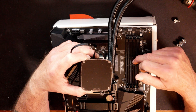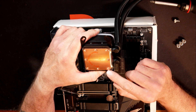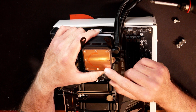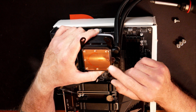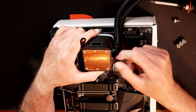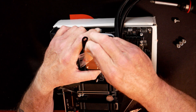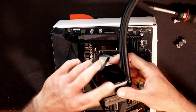Your hoses do need to be by your RAM slots. It says 'please remove before install' — if you don't remove this piece of plastic, your CPU will definitely overheat, and you'll have to take this back off to remove it. So you want to make sure you do pull this piece of plastic off. Let's get that pulled off — that gives you the nice copper plate there to attach.